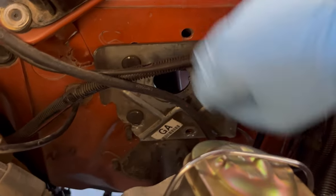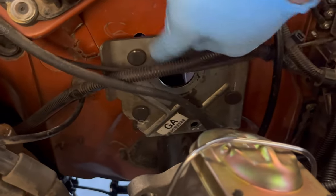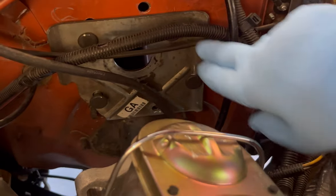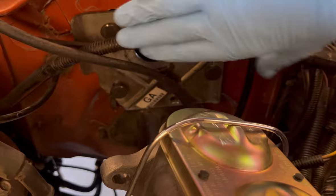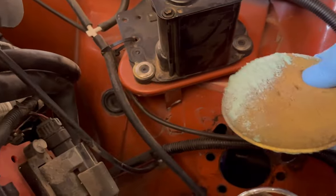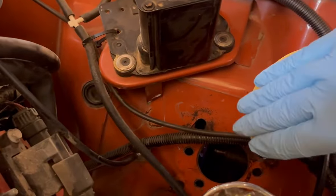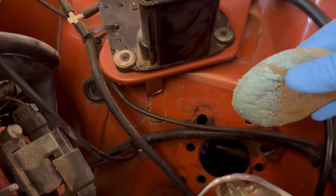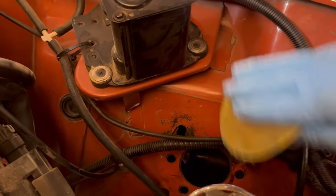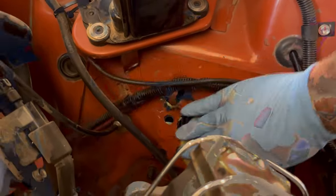Okay, you can see the plate. Looks like it fits nice, but to me, retrofitting is really harder than starting from scratch. I lined this up and marked it and then drilled the holes. Unfortunately, this may sound really weird, but I'm gonna wax this surface really heavy before I put this booster in because that'll help prevent rust getting sandwiched between these two.